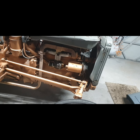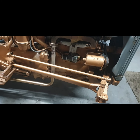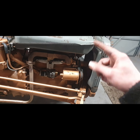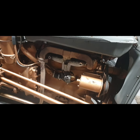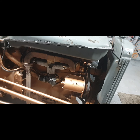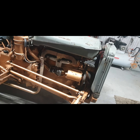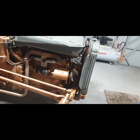I've been noticing lately it's been running very rich all of a sudden, and I had to keep tapping there to try and clear it. I'm fairly sure the TVO tank is a bit dirty as well — the petrol one's perfect. I need to find a tin of tank sealer and splash it around in there. Until then, we can keep an eye on the sediment bowl, keep it cleaned, and see if that sorts it. That would be another job sorted — we're knocking off a good bit of this project, really trying to get into the finer details.